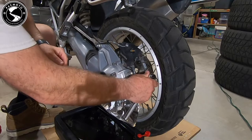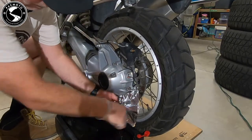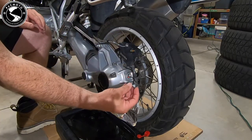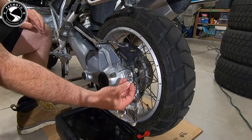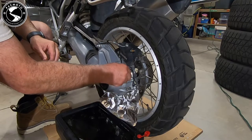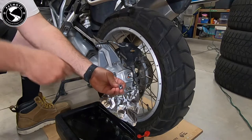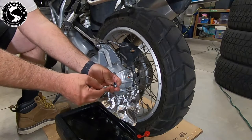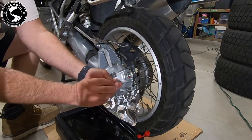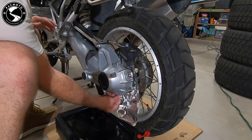I'm going to remove the filler plug first. When I pulled out the filler plug, you may be able to see that there's no crush ring visible — I was wondering where did the crush ring go. Well, it's still in there. Let's make sure we get this crush ring out because we don't want to have two crush rings in here. We will put in a new one on this drain plug. Make sure you clean out all the gunk that gets stuck down in there. There's a little magnetic piece in here that attracts any metal shavings. We're also going to replace this O-ring. I took the O-ring off — I have another one, sliding it on from the top. It fits right down in that groove, and then we will replace this drain plug.